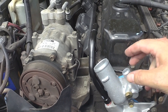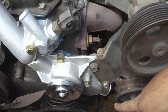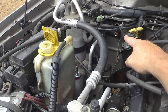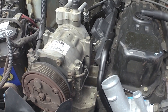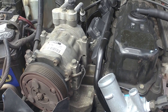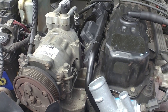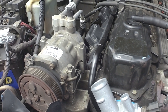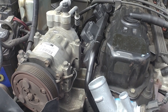I'm going to replace the top radiator hose, bottom radiator hose, and both heater hoses which connect to the heater core over here with silicone hoses. Rather than replace the leaky hoses that were brittle and dried out — probably baked from all the heat that comes from these engines — I decided to go with a hose that maybe will last longer.